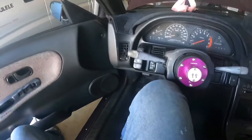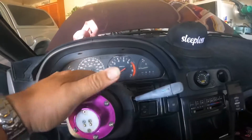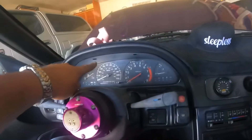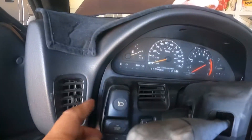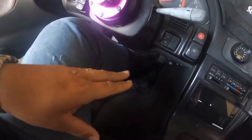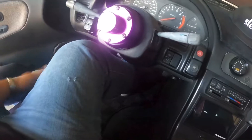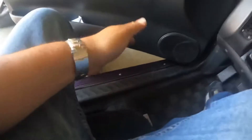From the video I saw on YouTube — it's like a five-year-old video — we take off this panel, the fuse panel, the under-panel, the steering wheel cover, and then drop the two bolts which drop the steering wheel down a little bit more. Then we take the top two and wiggle it out. These plugs are all the same so I gotta make sure I plug each one correctly back into place. I'm so out of it and I don't want to do this, but I gotta get it done.